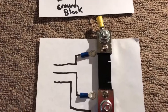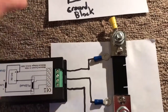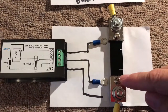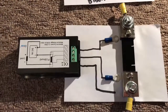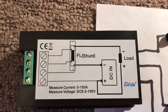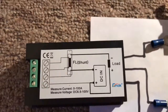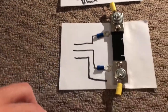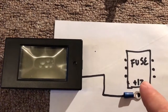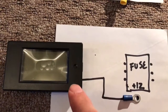Step two: I'm going to add three more wires and they'll go into the back of this box — one wire here, one wire here, and one wire here. I'll give you a close-up of the wiring diagram on the back of the box. The final and easiest step is to power it up — I'm going to take a wire off the bottom of my 12-volt fuse box, the plus 12, and run it into the monitor.